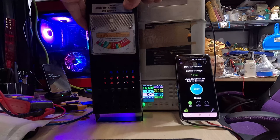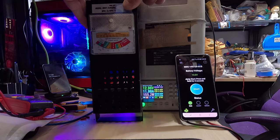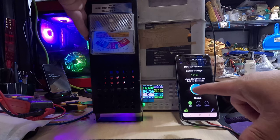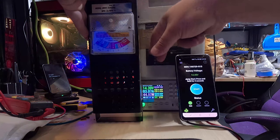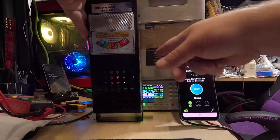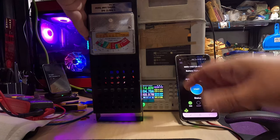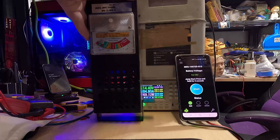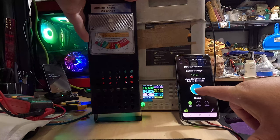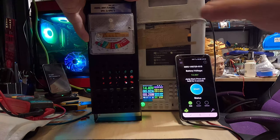Let's hit it again for about eight seconds. Perfectly fine — it definitely discharged more, but we've still got about three quarters of the supercap charge remaining. Honestly, cranking a four-cylinder car once it starts spinning is maybe 100 to 200 amps. This test load was 100 amps, so starting your car once will probably take about a third of the charge out of this whole unit. You've got plenty of reserve built into this. So let's let it recharge — that'll only take a few minutes — and then go out to the car and see if we can rig this up and fit it in the space where the old battery was.